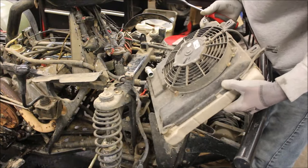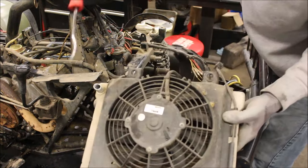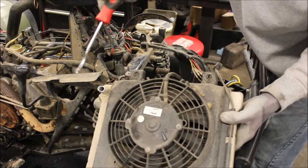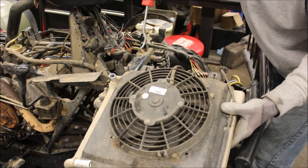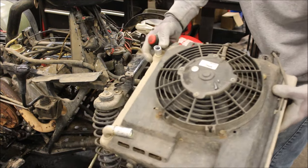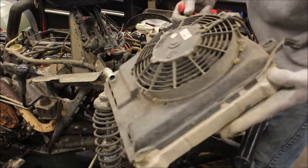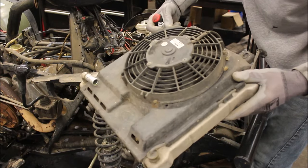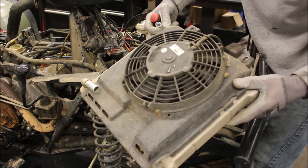See all that stuff from the hose stuck in there — all that black rubber. I don't trust this. You could flush this out with the radiator out, get everything cleaned out, if you didn't have the same problem I did. Say your radiator is just full of mud, caked with dirt — go ahead and remove it, flush it really good with a garden hose. This one I just don't trust, so I'm going to completely replace it.